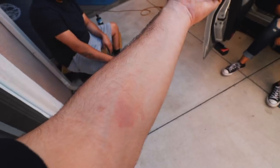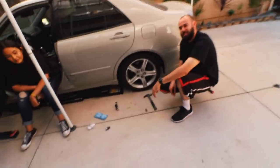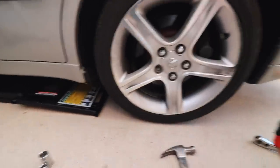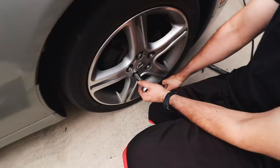This build is definitely going to be a good one. Just like the E30 — two hours later — we haven't made any progress on the car, and I got a huge burn because we've been trying to remove the wheel locks. The previous owner didn't check to see if he had the key for them. What we had to do was get a 19mm socket and actually knock it out. It's a 12-point, so that's what you need — you can't use a regular 6-point.